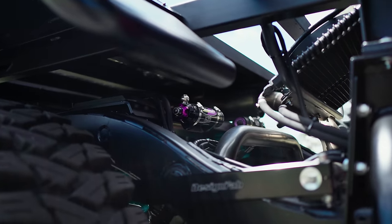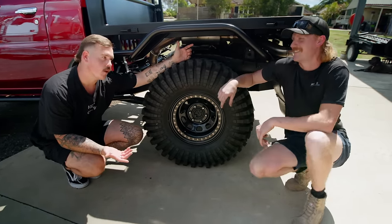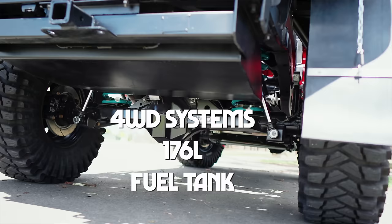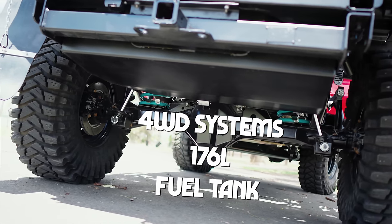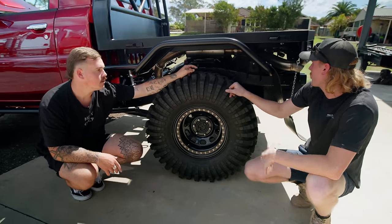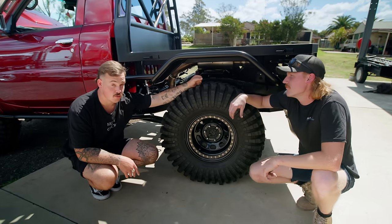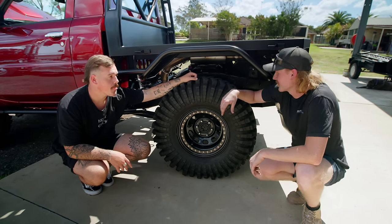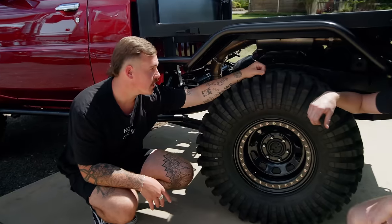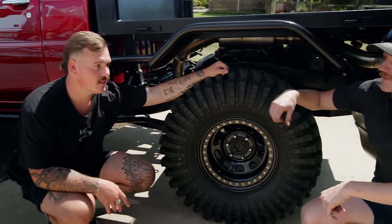There are adjustable remote canisters and a Full Drive Systems 176-litre fuel tank — a factory replacement that just sits a little higher. The sub tank has been deleted to accommodate the full link setup, and the biggest tank possible has been fitted in the back. A V8 petrol is going to be thirsty, so 176 litres should get you to most places.